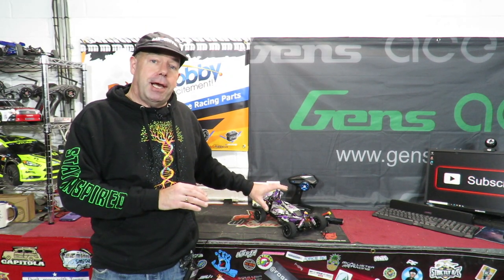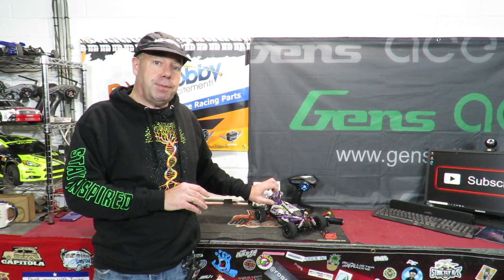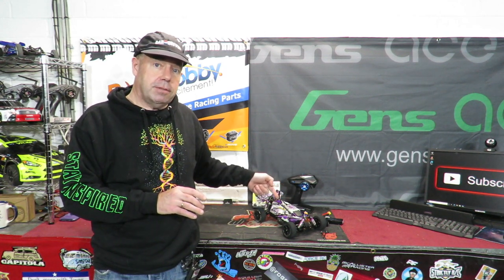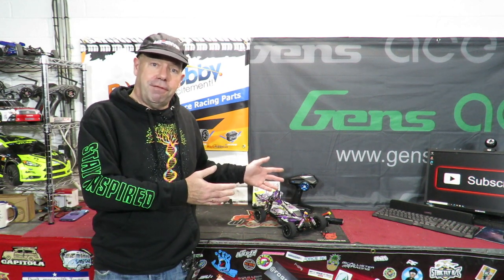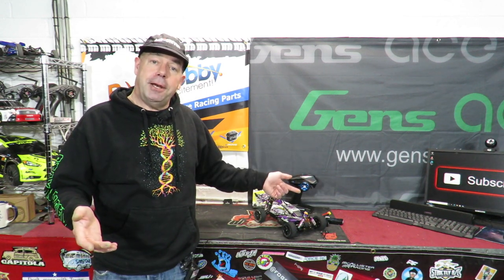A word of caution: if you're turning motor timing up to its maximum the motor will run warmer. When I've been doing speed runs I run it slow going away from me to keep the motor cool so I can really put the power down hard when it comes towards me. Also this motor is officially rated at 1S but I've been running it on 2S, and after the speed runs it's still lukewarm to the touch. It might get a little warmer on 3S but I'm confident we might be going faster than 100 miles an hour. It's been a learning curve - five days last week of crash after crash busting something every day, working on the setup to get that car handling well on the high speed runs. Now you know exactly what goes into a 100 mile an hour RC car build.